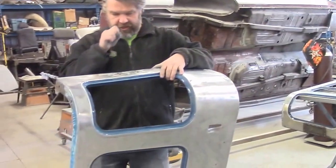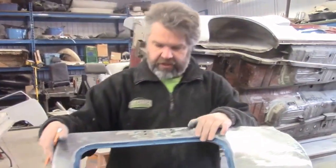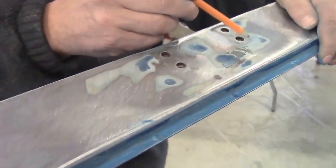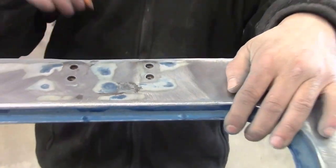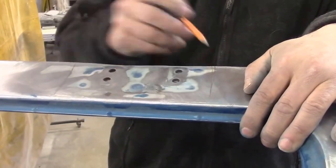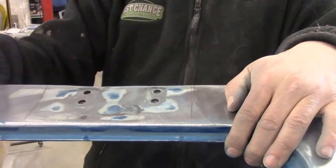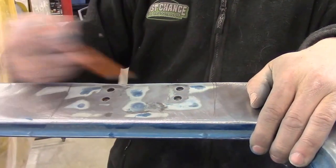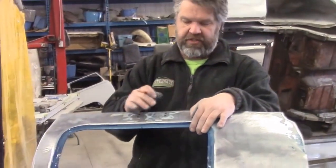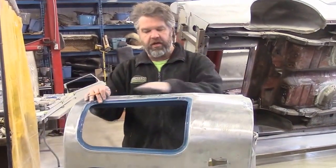With this driver's side section, as I mentioned in an earlier video, because we've changed the style of the rear doors, you can see there's a considerable amount of damage, denting, and binding. There's basically a template behind here — a section for the swing-out style of doors. We're going to cut this section completely out. There's a possibility of that plate rattling and building up rust over time, so we'll cut it out, re-weld the correct thickness of steel in its place, grind it smooth, and eliminate all the trapped rust and damage.